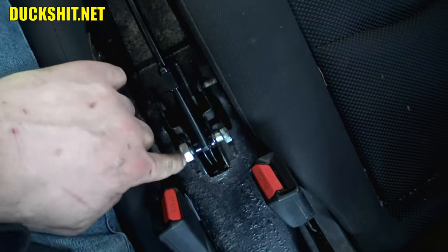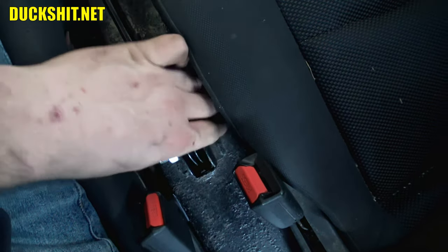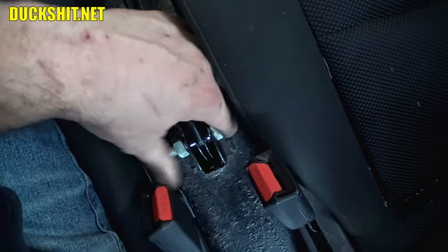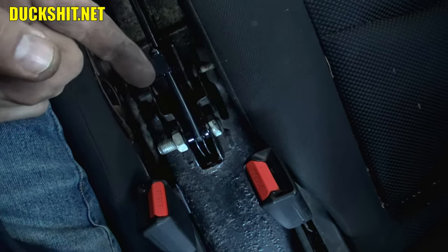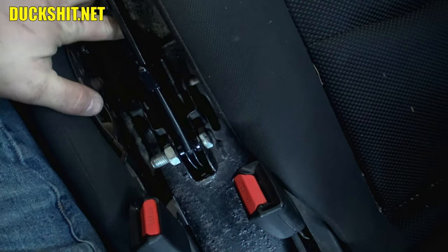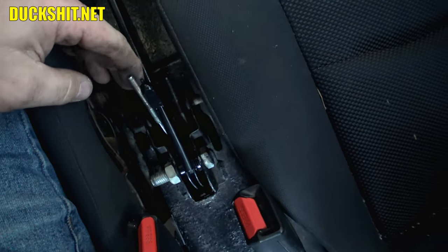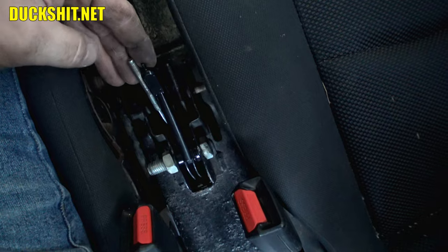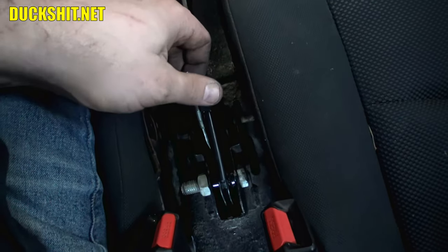Okay, I've got that e-brake handle back in here. Instead of using a stock pin, I actually just used a bolt. I'm gonna shorten this bolt down because it's just entirely too long. But nonetheless, this makes it stable and makes it a lot easier to pull the handle out when it's time to adjust or replace a cable. And here's the new cable that we just put in. Make sure this handle's down all the way. And look at that. It's a little past that. It's about a quarter inch past the little end here,